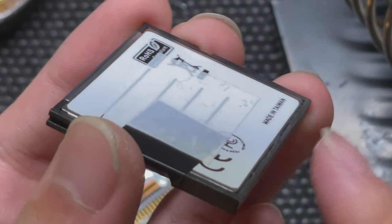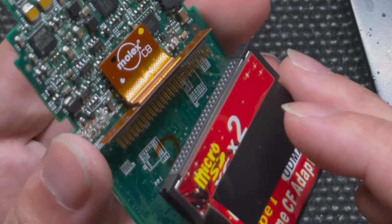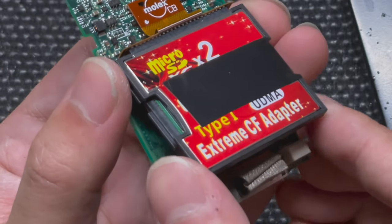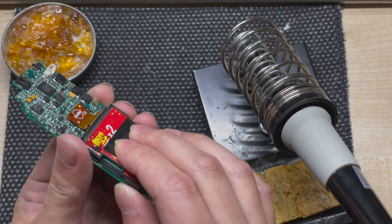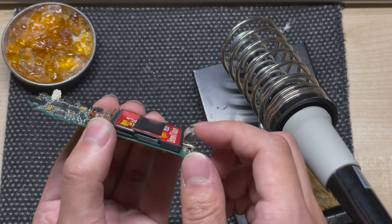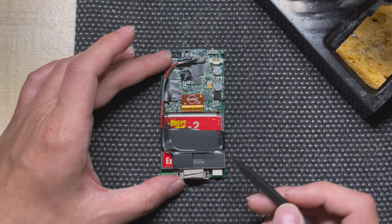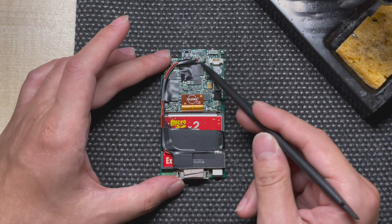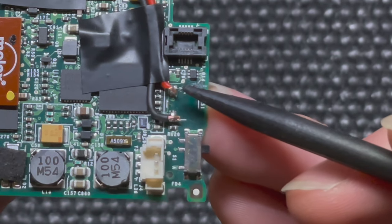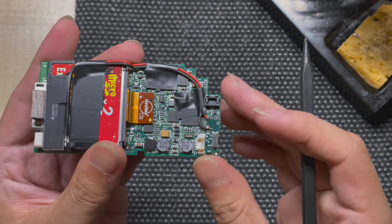After a bit of trimming we can see that the adapter is flat and it's time to install it. I've also put some double-sided tape on the back just so that it can sit flush properly with the board. To install the adapter all you need to do is line it up with the pins and insert it. Now you can see it sits flush so we have plenty more space up there for the Taptic Engine. In terms of positioning I've placed the Taptic Engine in the bottom right corner and fed the wires through to the left all the way up and around to the contacts. The original speaker had three contacts and we only need to use two. And because it's using an alternating current it doesn't matter which wire goes to which. So all that's left to do now is to solder them into place.